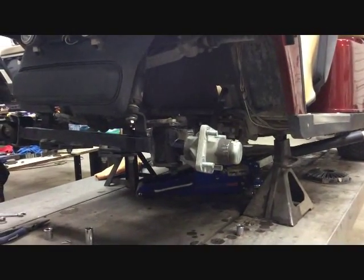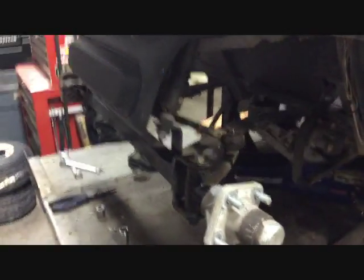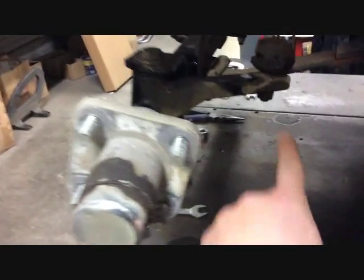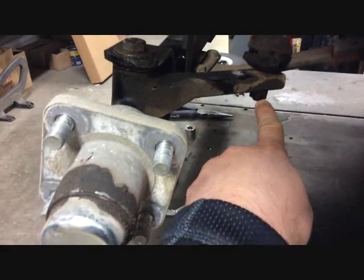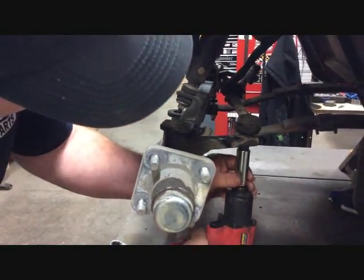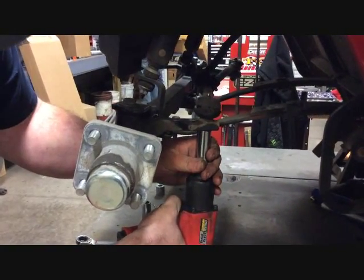You need to lift the cart up, place the frame on jack stands, and remove your wheels and tires. Then the first step, with an 11/16th socket, you want to remove the castle nut. We already took out the cotter pin. Remove the castle nut from both the driver and passenger side steering arms on the spindle. Save these for reinstallation.